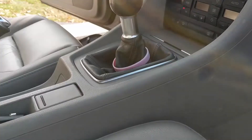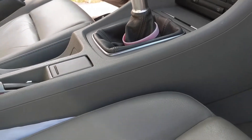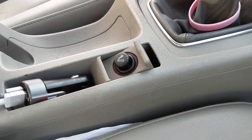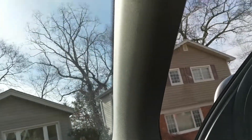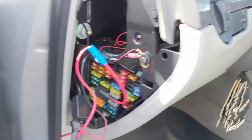For installation you have two options. The cigarette lighter adapter — depending on where your lighter is located — determines how you route your wiring. In my car the lighter is right here, so I'd plug it in, run the wire down, get it under this trim using the pry tool they include, run it up along here, tuck it behind this A-pillar, behind the headliner, and out to the camera.